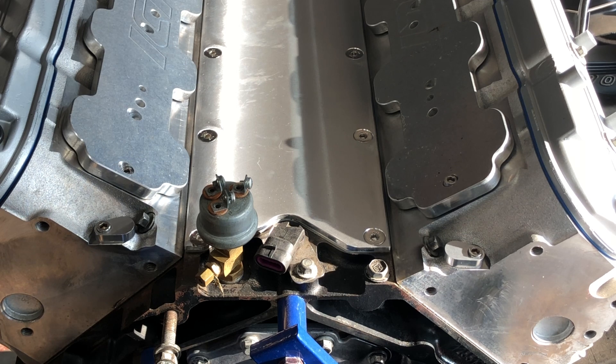This is an easy way to block off the rears on an early Gen 3 — the later Gen 3s and Gen 4s were blocked off from the factory. I'll be drilling and tapping my water pump with a 1/8 NPT hose barb so we can make a very short hose from the steam lines to the water pump. That way it's a very clean look with no hoses strewn everywhere — no weird fitting in the upper radiator hose, and no small-diameter line running from the front of the engine all the way to the radiator.